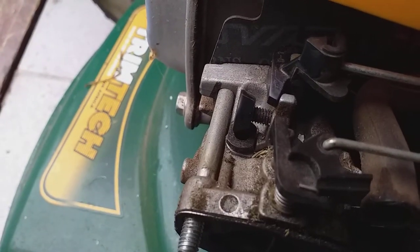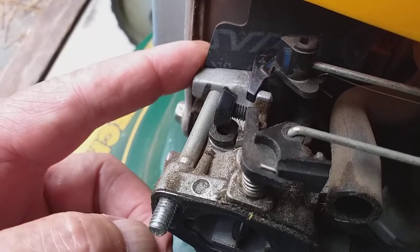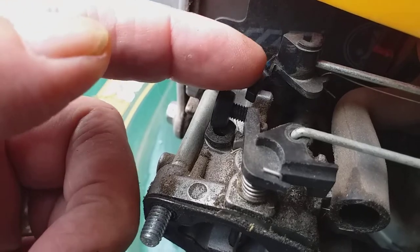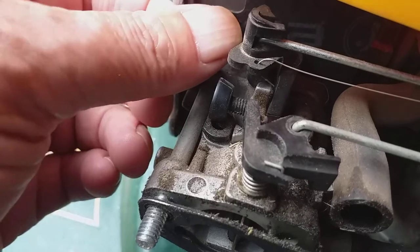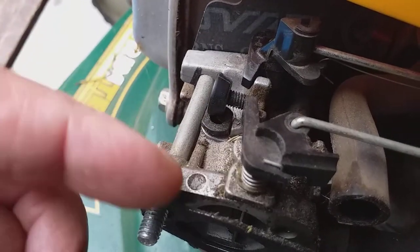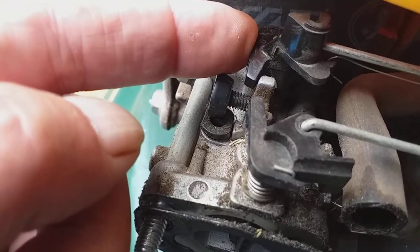Hello Tabu, I think I found a problem on your lawnmower. On the lever it is now set for idling. So you can see, here it is, this is the position for idle. And when the engine runs and you pull it open, it will go to there, which is run, full. Now what I think happened — somebody was in this carburetor before you and they turned this screw in fully, while the machine was running.